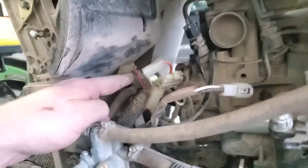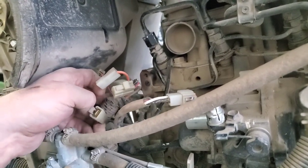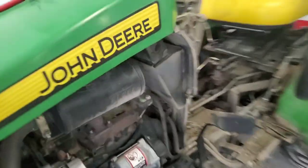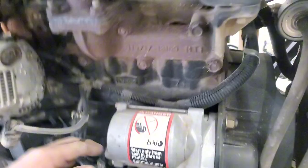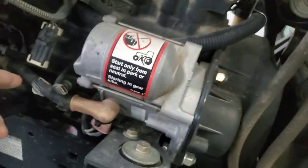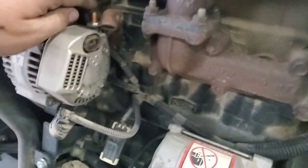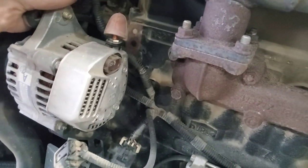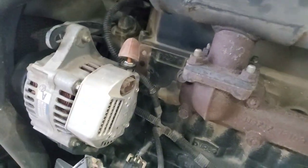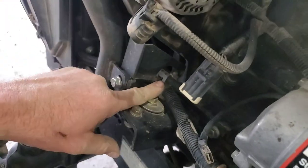From here you need to start working on the engine side, so you've got your fuel pump to undo. You'll have a few other pieces of wiring. This is where the main loom ends and it splits. There's a standoff right here on the back of the block. You will have your starter excite wire, your alternator, battery, and then there's a little clamp hole down right here behind the exhaust. We've got the coolant temp on the other side to take off, and then this one that goes to the battery compartment — make sure we take that off. There's a hold-down right there.